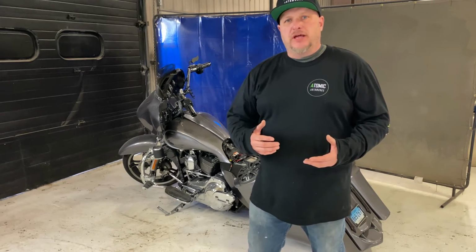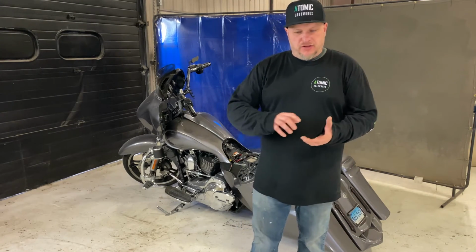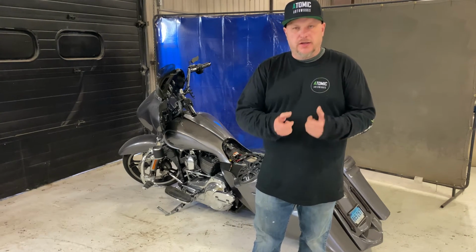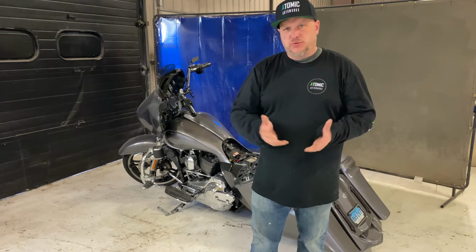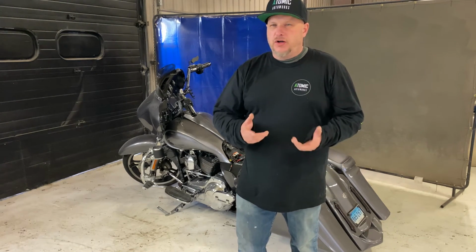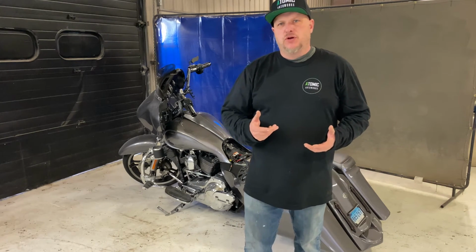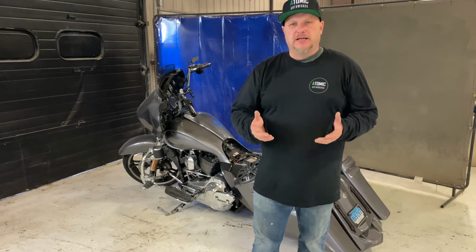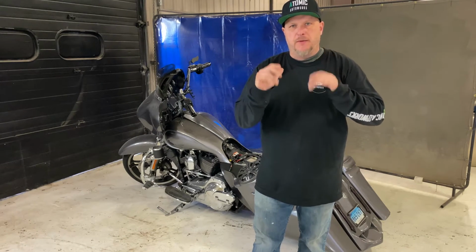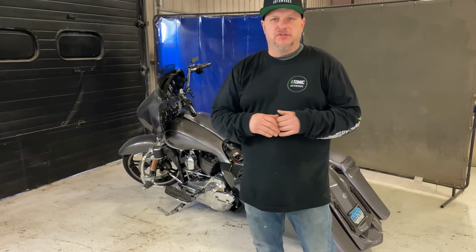I've said in the past how a lot of places use epoxy pans, and they'll actually make this really thick paste. Well, the problem we find with epoxy pans is, one, they're too thick, so it's really hard to get a nice crisp line and also keep the seat pan as low profile as we need it. Also, I don't know if people mix things wrong, but we've had a lot of epoxy pans that actually curl up, and they kind of do like an elf shoe thing where they flare up in the front and the back. Once that happens, the seat pans are garbage.